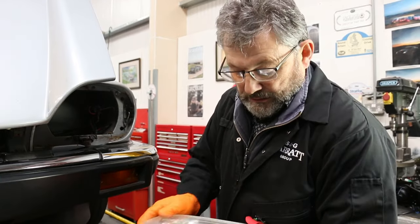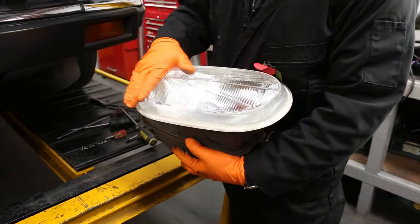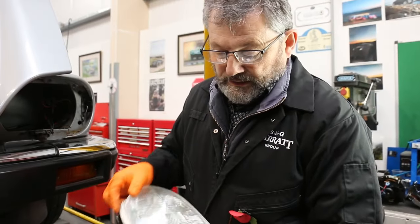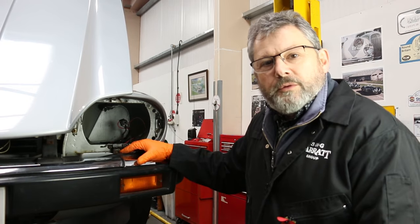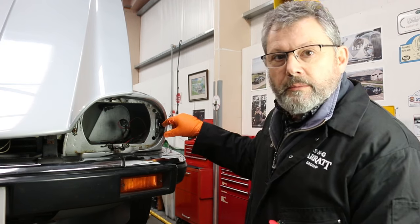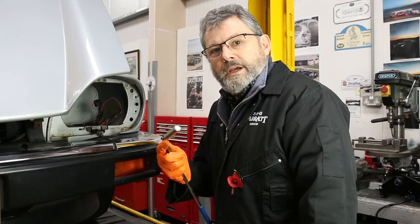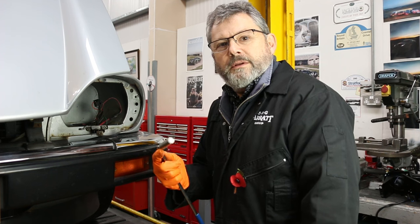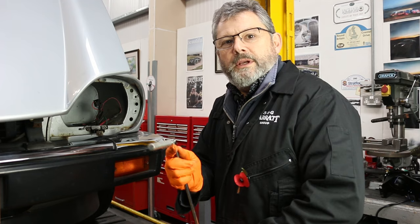This one is actually not a bad example, but they do suffer — quite often the silvering inside will go yellow and you lose the effectiveness of the lens. Now the lamp unit itself is removed, we just need to get rid of these adjusters as we don't need those — they're all part of the replacement twin headlamp unit. I always keep a magnet on a stick handy because you can guarantee at least one screw will disappear somewhere you can't get your fingers.